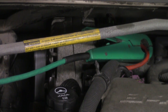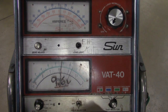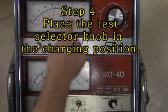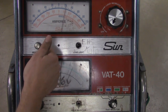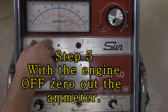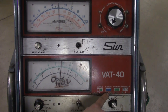Now let's take a look at the VAT40. You want to look at the amperes and the volts, and we have our volt selector, field selector, and test selector. We're going to do a basic charging system test — take the test selector and turn it over to the blue charging scale, which means we're going to read the top blue scale. Right now my car is not running, but the needle is already deflecting showing about 22 to 23 amps — that's a false reading. Because the car is not running, I want to zero this out. I'll turn the zero adjust until the needle lines up with zero. After that I won't touch the zero adjust at all. My volt selector is on internal 18 volts, field selector is in the off position, and test selector is at charging.